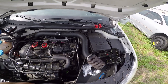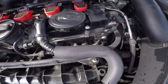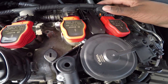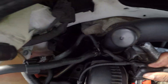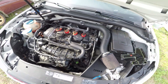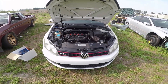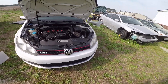I'm going to put those coil packs back in before I put the screws back in just to be safe. Alright, I got the coil packs in, I got everything buttoned up. Now I just gotta push these connectors back in. My plugs are kind of cracked so one's only going to go on so far. I also wiped off that hose in the back going into the intake, so I'll keep an eye on that. That's how you replace the PCV valve on a Mark VI GTI — really simple. If I wasn't filming I probably could have done that in about 10 to 15 minutes. Not hard at all.